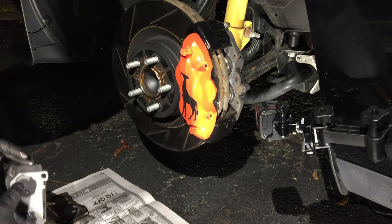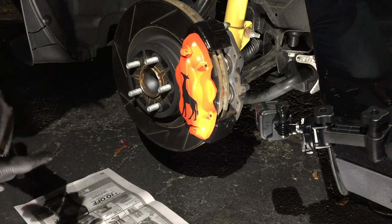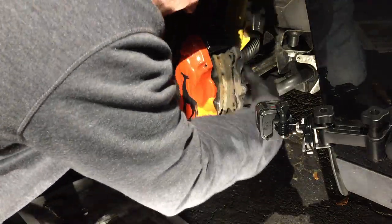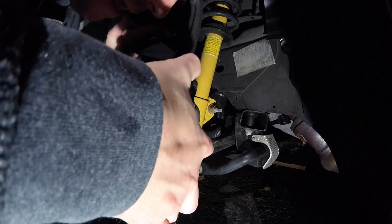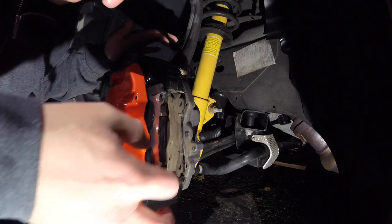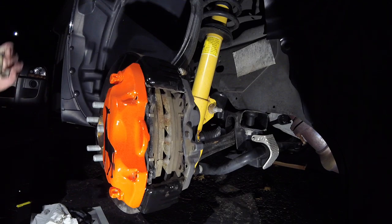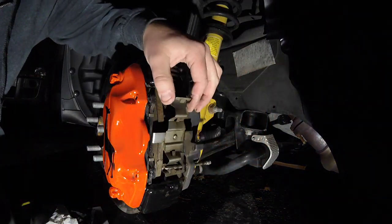If you notice, I didn't put grease anywhere else on these assemblies — just in those two areas I showed you. We're gonna put everything back together. It was really difficult getting the pads back in, so what I wound up doing — and this is on a newer car with only a couple thousand miles, so the brake fluid wasn't dirty — I popped open the brake fluid reservoir and used my thumbs to push the two pistons in the brake assembly back a little bit to give me more room, then sealed up that brake fluid reservoir. After that I was able to easily slide the brake pads back into place.